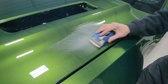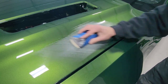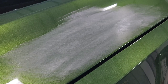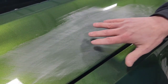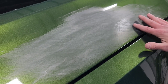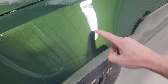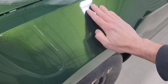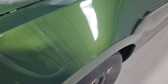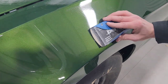The hood actually laid out pretty slick, so there's not really much texture to it. But no matter what — I don't care how good you are off the gun — it's always going to have some form of texture. You can see that slight texture; the hood is slick, but there's always going to be some kind of texture there. That small dust nib and this area here — that's what I would call a minimum factory-like peel, which doesn't give it a bad appearance, but when we're looking for a glass-like finish, we want all the texture gone.